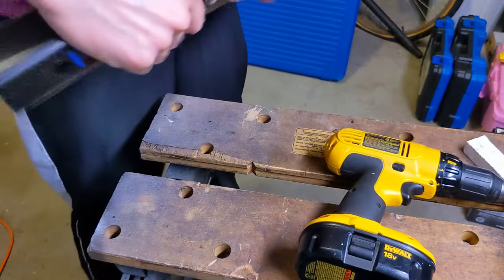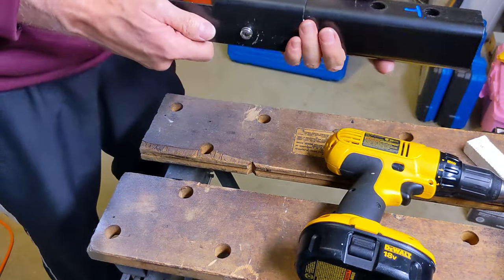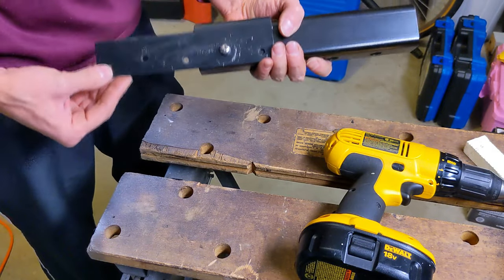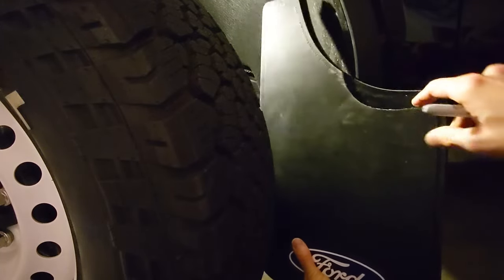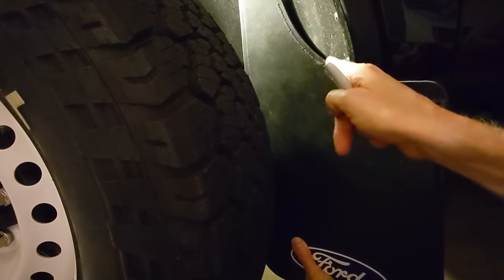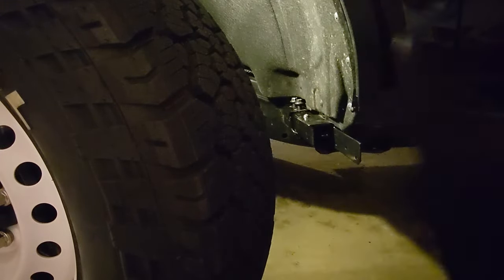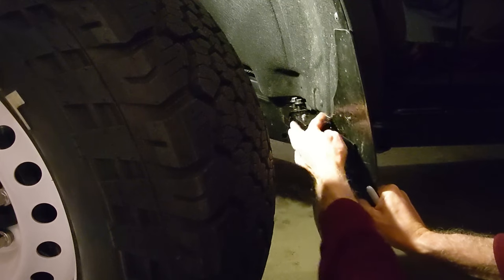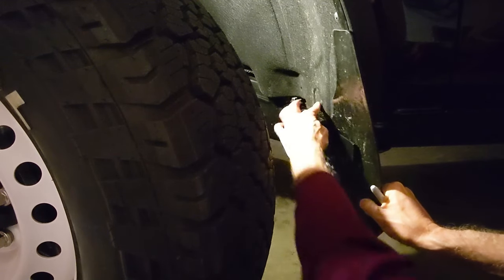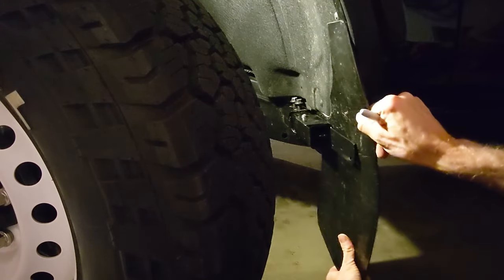All secure. Now I'm ready to install it back on the truck and mount the mud flap on the three available holes. One thing to note: I carved out a little section on part of the mud flap — a sharp razor blade makes it really easy to cut. The reason is that when I put it up in the wheel well, it fits snug against the inner wheel well and I didn't want it dragging too close to the ground. Carving that bit out allows me to slide the mud flap up to the exact height I want.